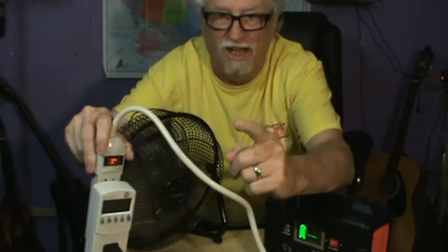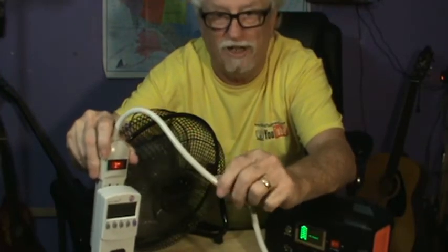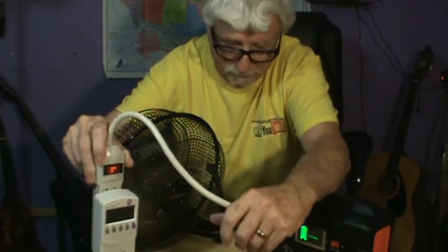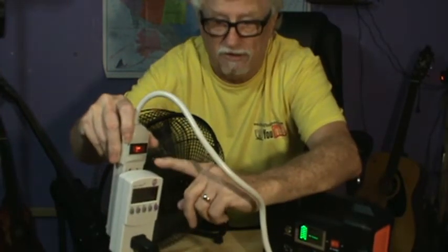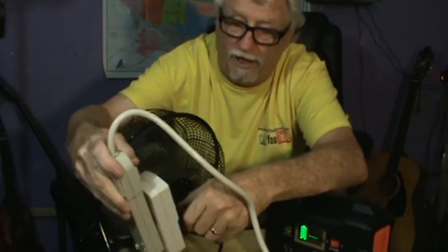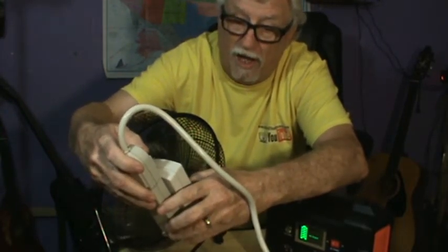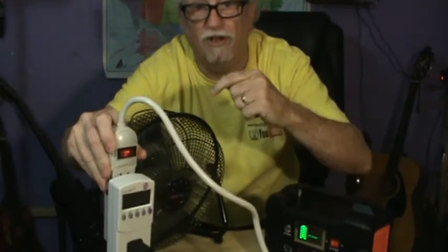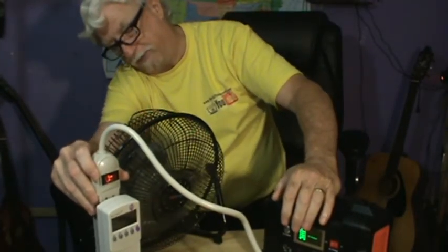Next I've got a little refrigerator in my van and I'm going to check that out, but it's 12 volts so there's no way to hook up the watt meter to check amps and watts directly. The fan has settled down — it's at 20 watts, 0.32 amps. The label says 0.80 amps, so I guess that higher figure is at high speed.